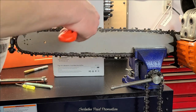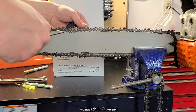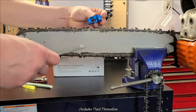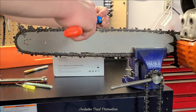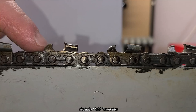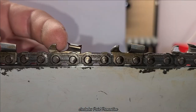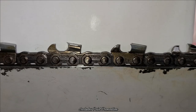Okay, it's pretty smooth. I'm gonna take one last little hit like this and flatten it out. Take the burr off the edge, just like that. And now, it doesn't hit when you come across like this. Okay. See how nice and flat the top of the raker is here? Okay, you can see our little cat hook, how clean it looks there, right? So it looks absolutely beautiful.